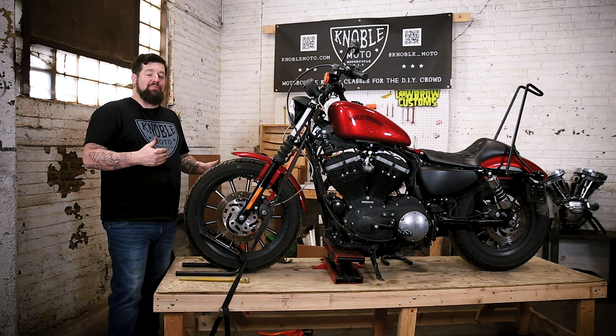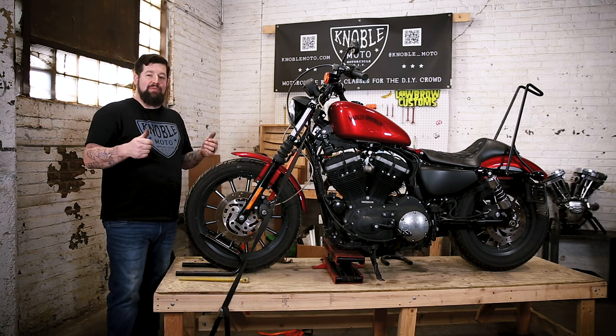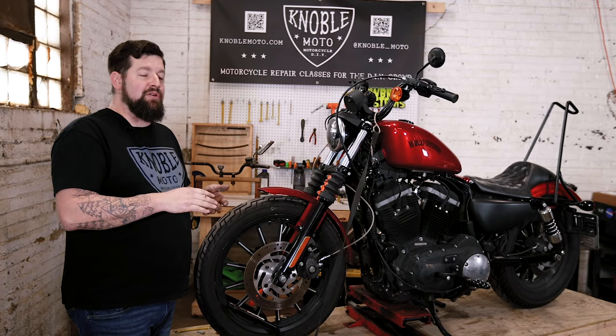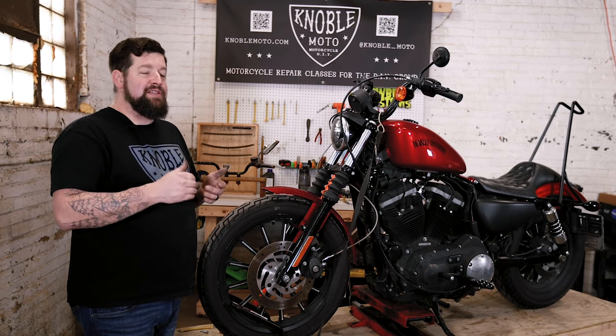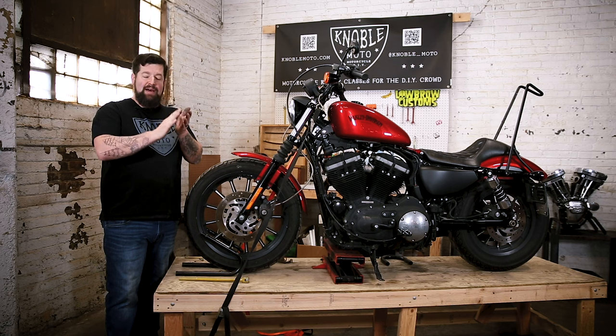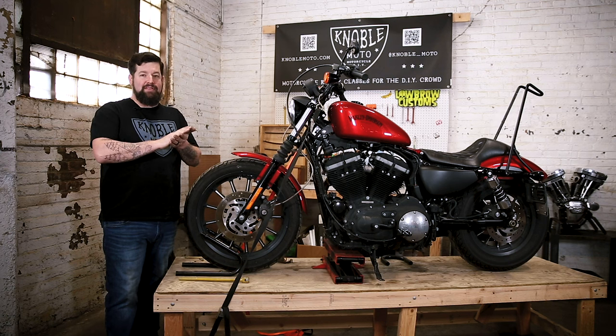You may need to replace your front brake rotor over time because as you're braking, your brake pads faintly wear down small amounts into your brake rotors and you end up getting grooves. The downside is when you replace your pads, the new pad just sits on top of those grooves and doesn't actually grab the entire surface of the rotor, so you lose a lot of your braking ability due to that reduced surface contact.